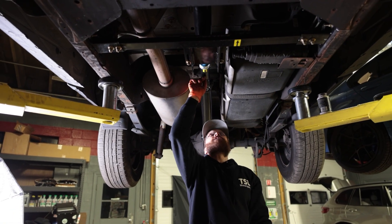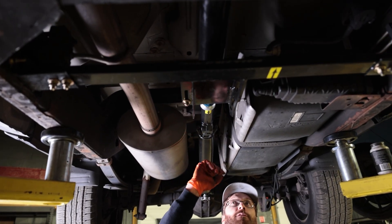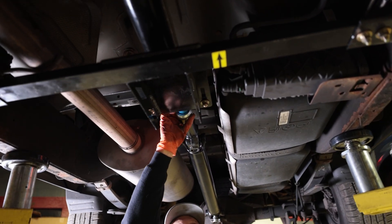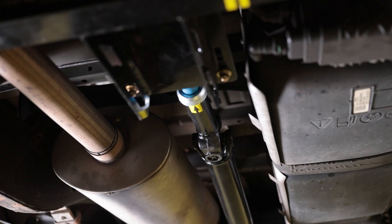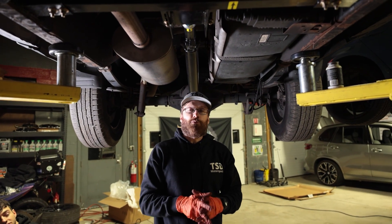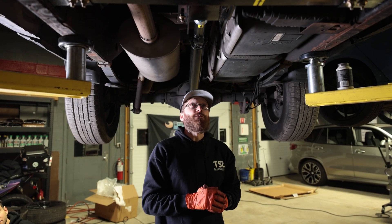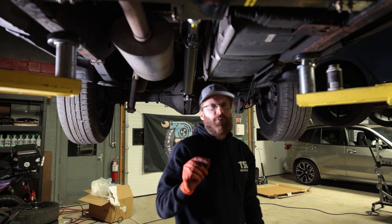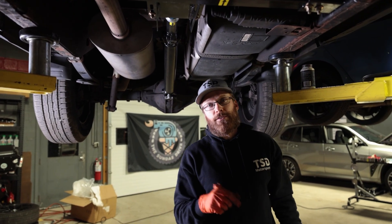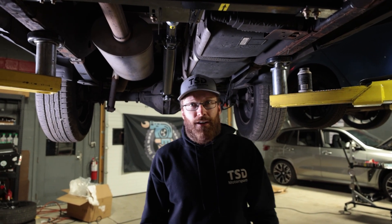That's all there is to installing your two-piece driveshaft. One thing I'll note is it would be nice if they added external plates on the outside of the frame to better distribute the force of those bolts and nuts. But other than that, this seems like a pretty solid kit — everything is really heavy duty and feels well built. They do have that zerk fitting, so you may want to top it off every once in a while with some grease. If you have any comments or questions, please let us know. Parts are down in the description, and when you go through our links it really does help us out. We'll see you back in the next video.